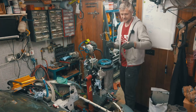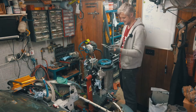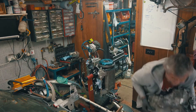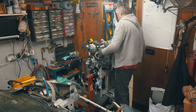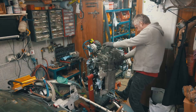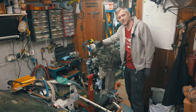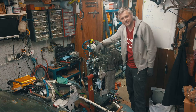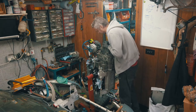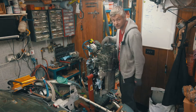I forgot the little aluminium spacer — originally it was one piece, but because I had to grind it for the dry sump it's now in two parts. It's fairly easy overall, but also not easy at the same time — it's heavy, it's awkward, you need to check tolerances and deal with the adapter plate. But at least this gearbox is a lot easier than the original Renault chocolate box.